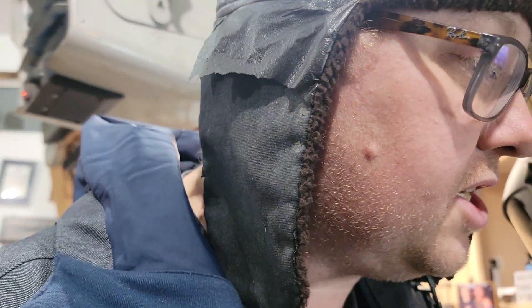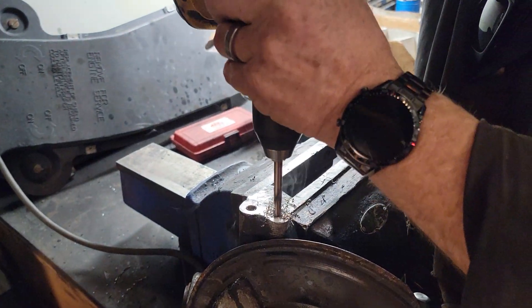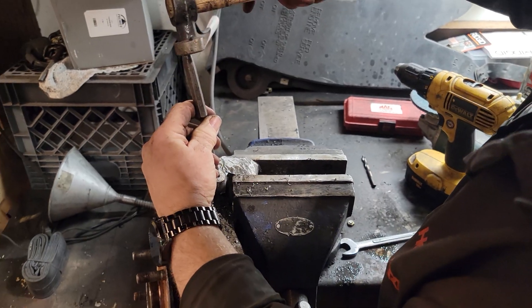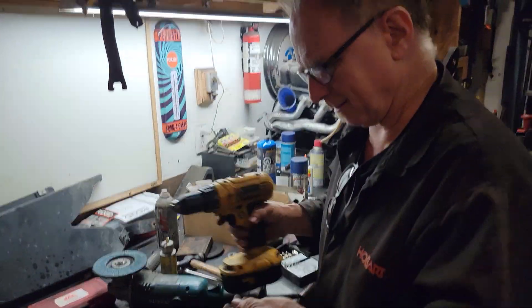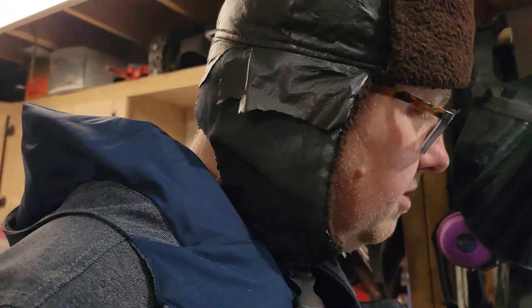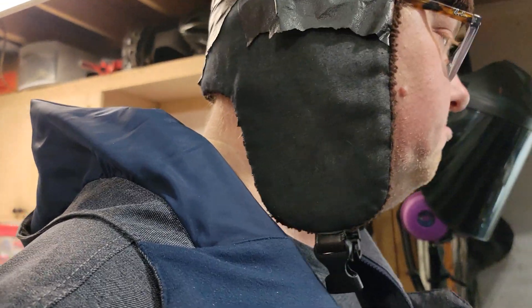So far that's not working, so we're just going to keep upping the drill bit size until it basically wears out. Very rarely I've also been able to use a punch on an angle to chip away at it and crack the bolt going down, but haven't been successful with that lately. That thing is way too thin — it's good and seized. We'll go with the 3/8 — bigger is better. The 3/8 is pretty much the size of the hole, about 10 millimeter threads — it'll actually take it right to the edge of the thread.